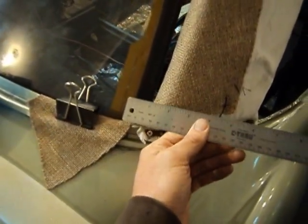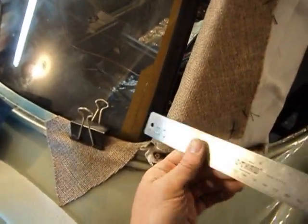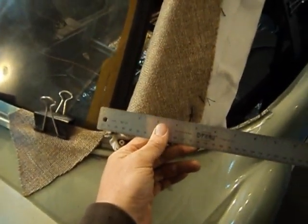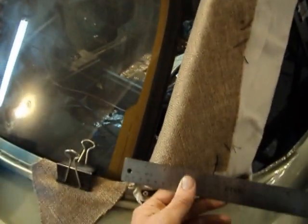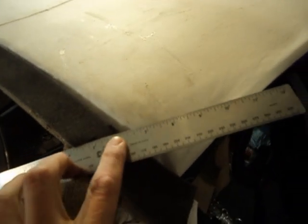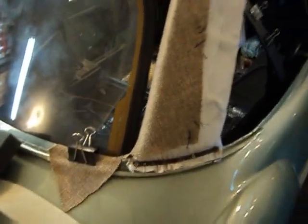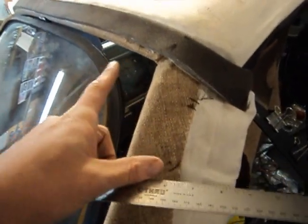Taking a quick look with a ruler here — the rubber on the convertible top should just about meet the rubber that surrounds the rear window. We just need to fill in this gap with the listing that's sewn into the convertible top. The most critical area is this corner — that's our biggest gap. Measuring down from the rubber, we're about four inches of opening. To be good, we'll leave about six inches of listing length, and six inches will get us enough all the way around the top.